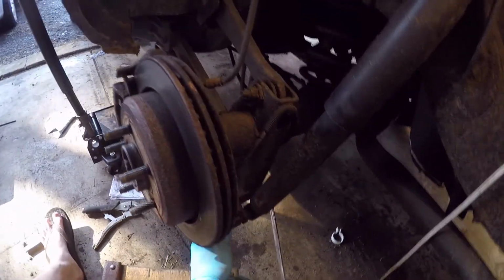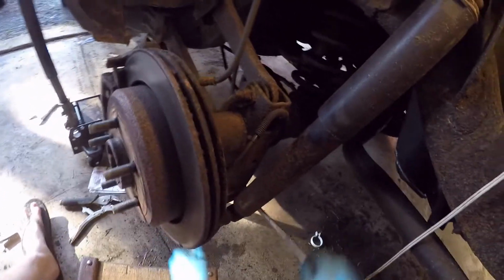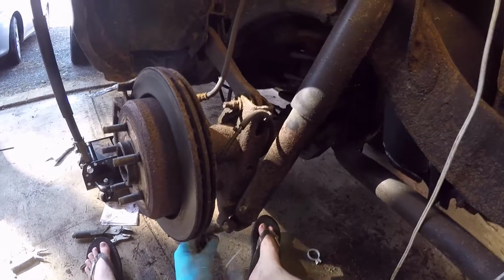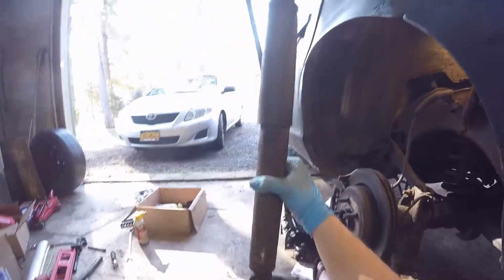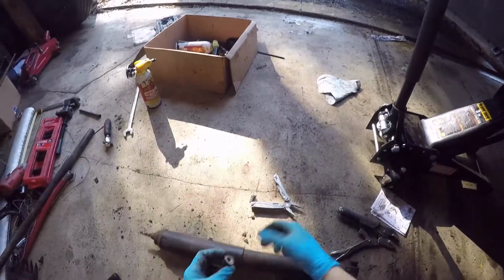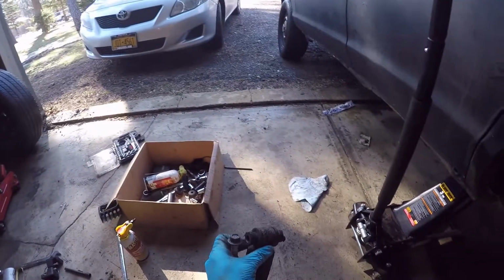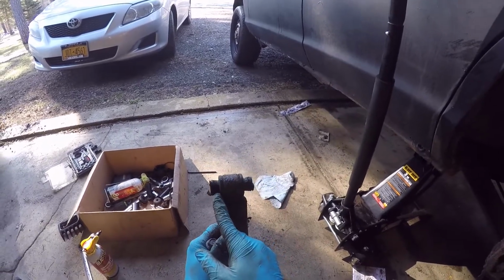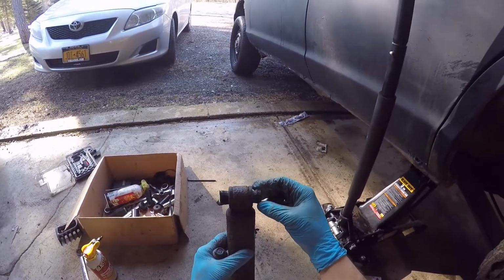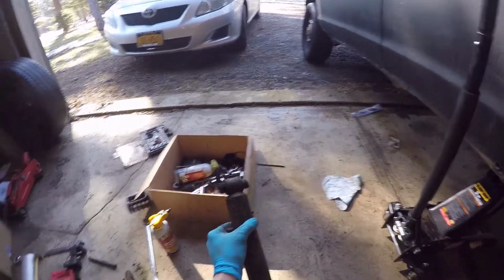Okay, that's pretty well broken off. Ratchet. Make sure that's not going tight. And there we go. And we're also going to want to keep this because the other shock is just this middle metal bit and those two tiny bushings. So we're going to need to cut these two ends free and use them as spacers. That's what we had to do on the last side.